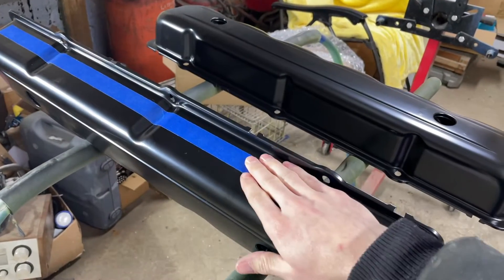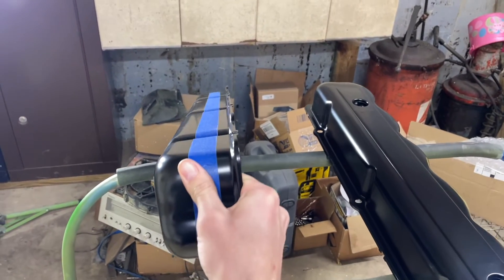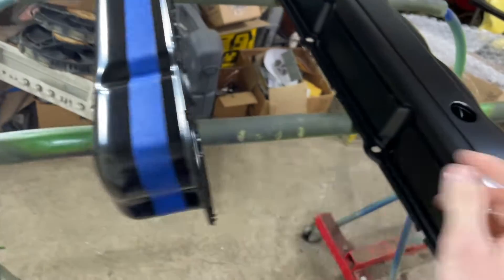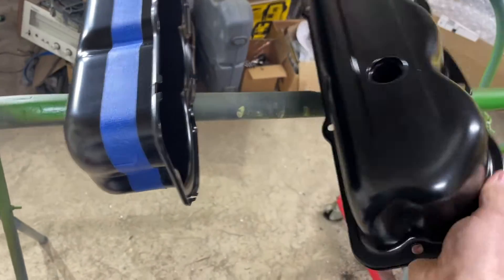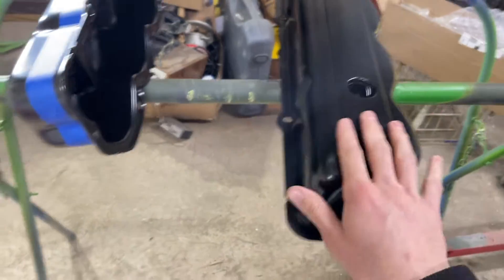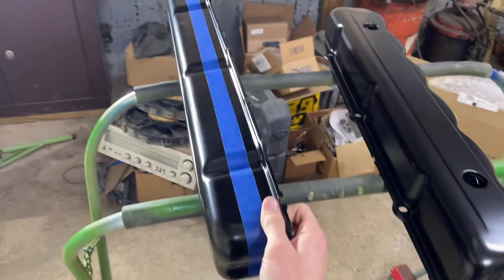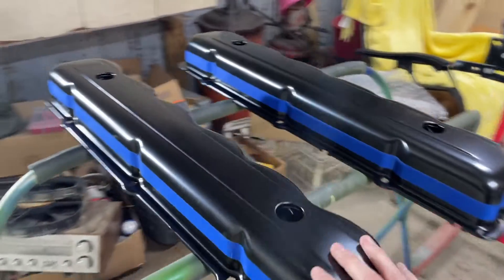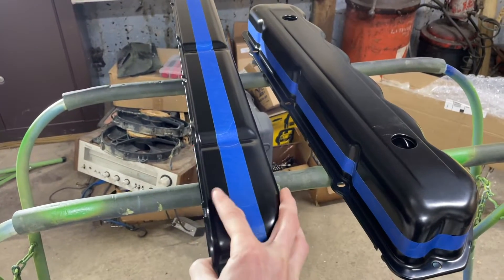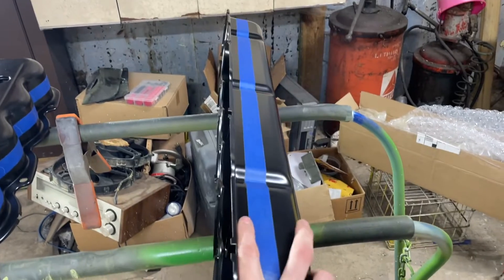I'm going to use tape as a guide for my cutoff wheel. I'm just eyeballing this — it looks like I got it pretty straight. I'm going to cut right along that bottom edge and then do the same thing on this one somewhere up here, and then I'll have my two pieces that I'll weld together. I'm just going to tack them for now until I get the rockers and make sure everything clears. I'm going to cut on top of this line, which is one and three quarters from this flange, and then cut on the bottom of this line, which is a half inch from this flange.